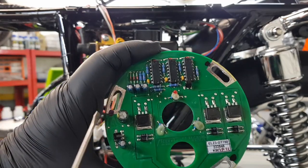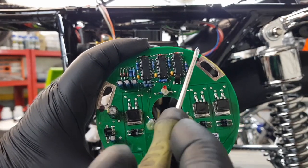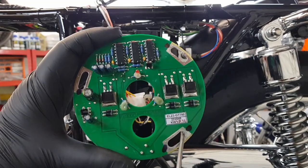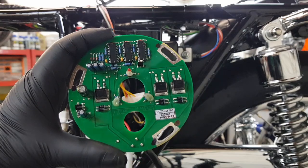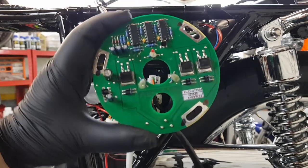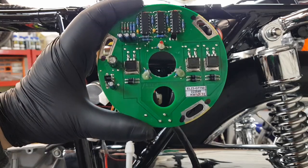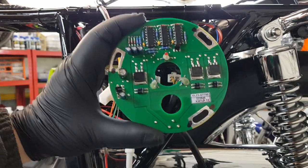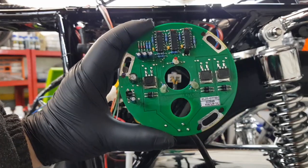Where I've put a black felt tip — there, there, there and there — I extend the holes very, very carefully. Because when you're setting the timing by rotating this, you don't get enough movement. So I prefer to do it before I fit it because it's easier.